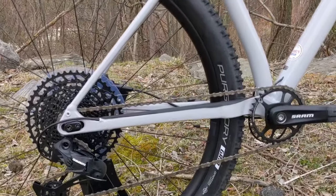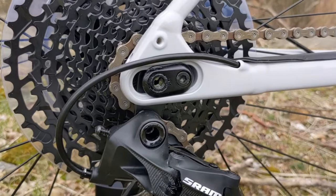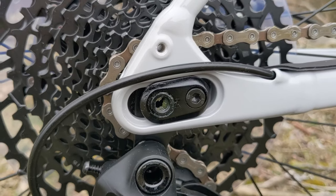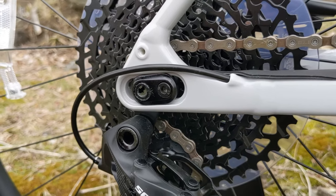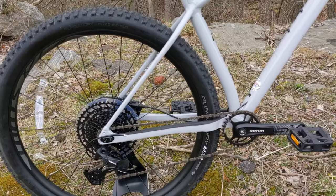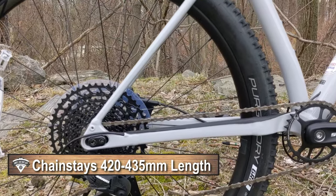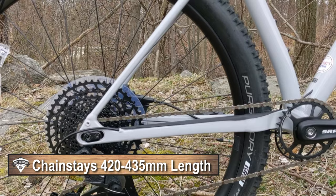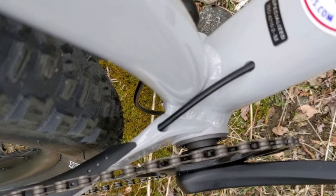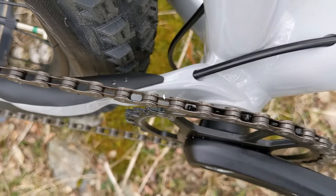In the back, this bike is set up with what Specialized calls their single-speed dropouts. The single-speed dropout is a sliding rear dropout with 15 millimeters of travel that it can go forward or backwards on. That allows you to customize your geometry, run a smaller 29er tire, or even set the bike up 650 plus if that's what you want. The chainstay length in its longest position is 435 millimeters — pretty short — and in its shortest position it's 420 millimeters, which is road-bike short, which is pretty cool.